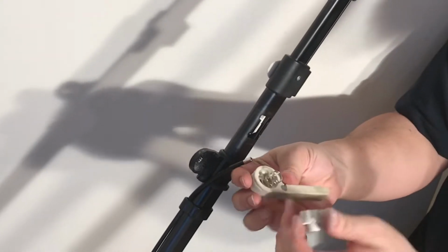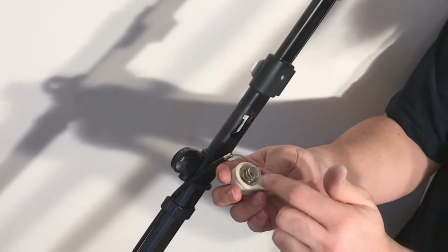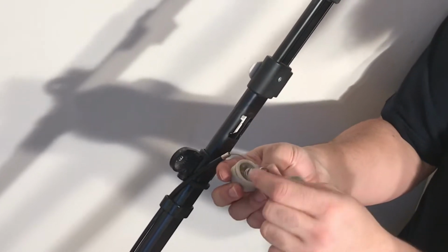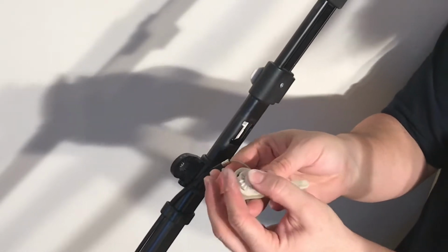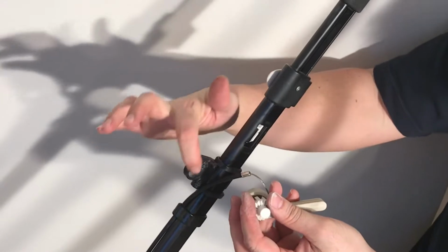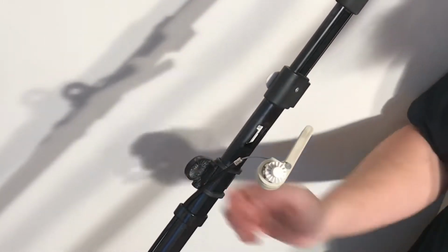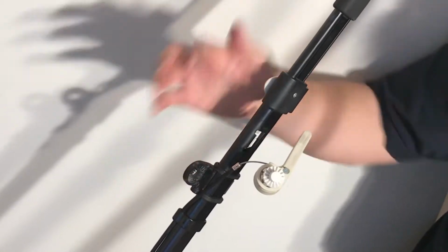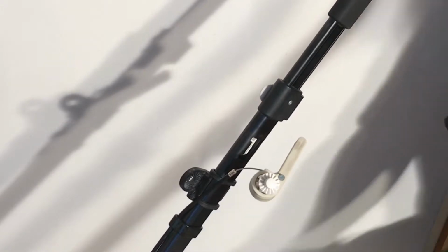So the brake lever comes in two parts, with a gear teeth sort of system holding them together, and a spring here. When it's depressed, it pulls this outer set of teeth away from these here. Sometimes you can get a lot of dirt and stuff here, or these can become a little bit worn down, at which point the lever will not hold properly in various sorts of positions.